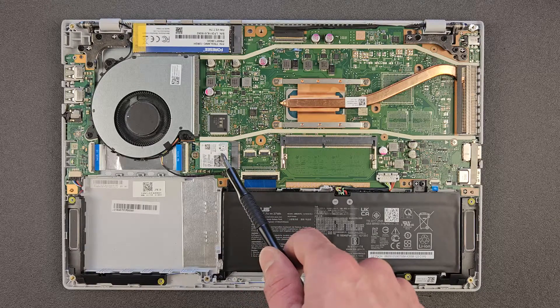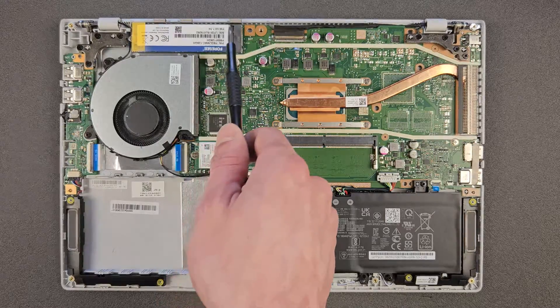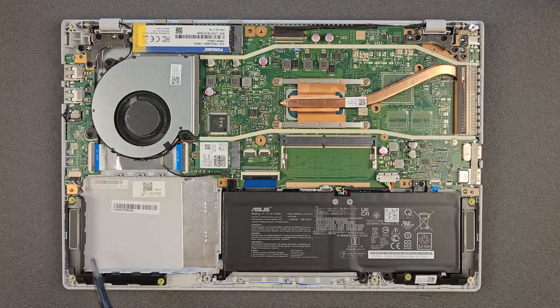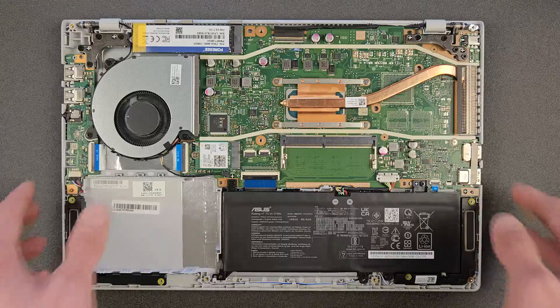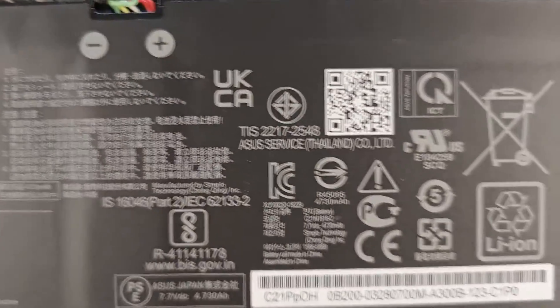That's your Wi-Fi card — we'll have a closer look in a minute. CPU fan, very strangely positioned I have to say. And that's your solid state drive — 128 gigabytes at the moment. Interestingly, this laptop actually has space for a 2.5-inch drive and a connection on the motherboard for it, but there's no ribbon or anything included. I don't know if you can find one, but you might be able to install an extra drive — I've never tried that personally so I can't recommend it.